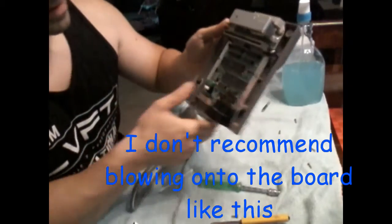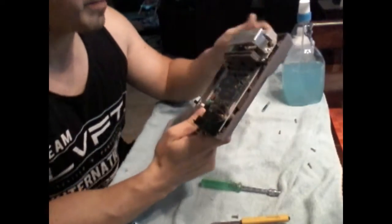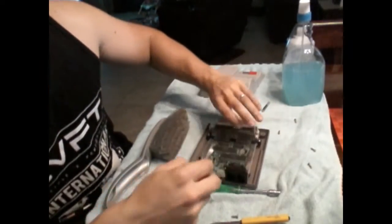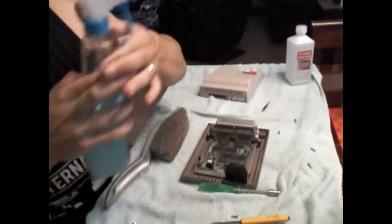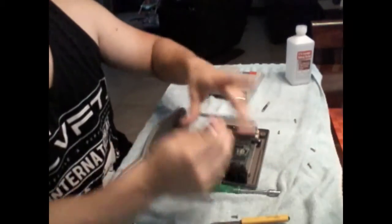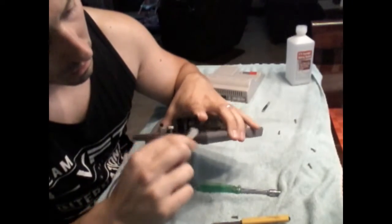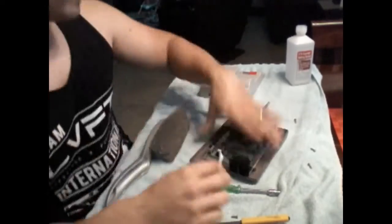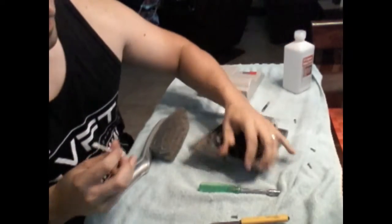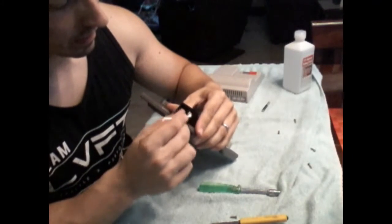And that actually cleared some gunk up that was in there, and in around our reset button and power button. What I'm going to do is, right where these controller ports are, take some Windex and a little Q-tip and get those contacts really good, and then I'll get it with some alcohol as well. This is 90%, actually 91%, so this is going to dry relatively quick. I like that Windex we just put on there. It might sit on there for a minute or so.